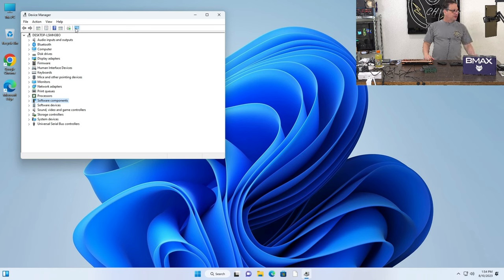Arvail says, Bing search said the Intel 1000NG4 does include a TPM function. The CPU has a TDP of 9 watts and comes with Intel AES new instructions and secure key. I would hope that there's a BIOS setting somewhere or a BIOS update that addresses this. A CPU made in 2020 should have a built-in TPM module.